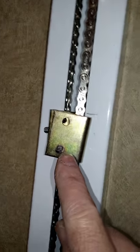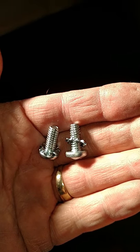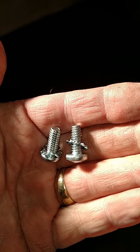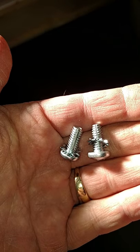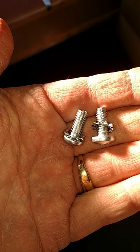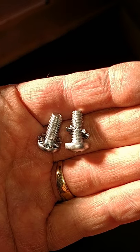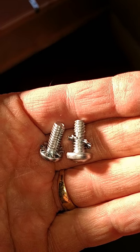I have my three-quarter-inch bolt here started so I can work with this once I tuck it back inside. I brought the chain out of the track a little bit so I can get everything on there — it'll just slip right back in. If it's longer than three-quarters of an inch, it won't be able to go back in and get the bracket up over it. On the right one that is a self-tapping screw; on the left one that is a regular screw. The regular ones go into the clamp that grips the chain — there's only two of them. The four self-tapping screws hold the brackets on to the mechanism.